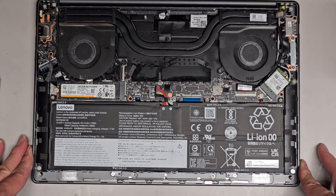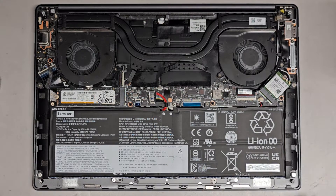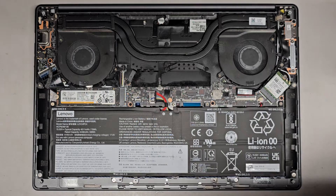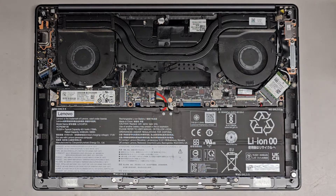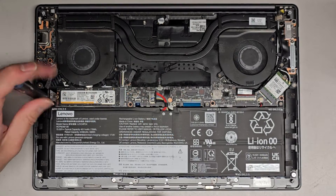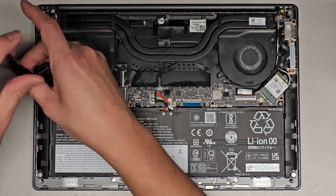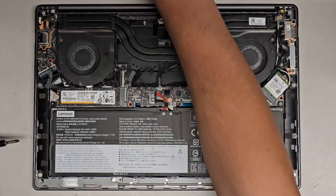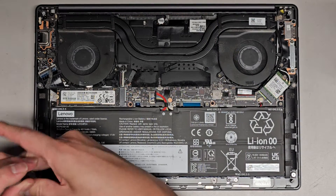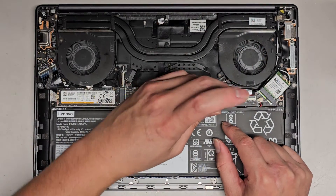Let's go ahead and pull the battery out here just to be safe. We also need a thumbnail, so let's go ahead and center this thing and get a thumbnail. I'm going to be doing this kind of somewhat blind since I don't have my usual setup. We're going to switch over to a JIS-1 or J1 screwdriver, and we're going to undo the screws holding the battery in place. Keep the screws in order — we're also going to undo the screws holding the speakers in place. Got another one for the battery over here.